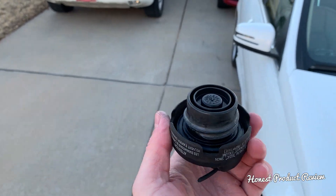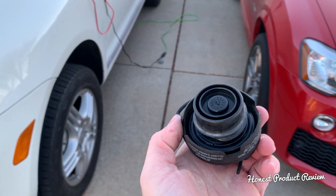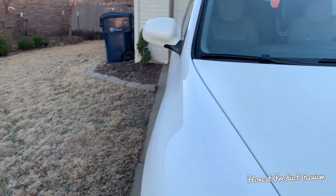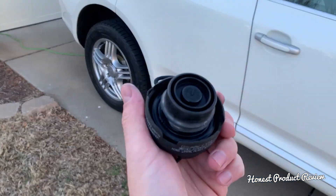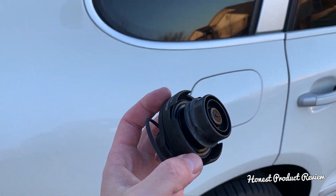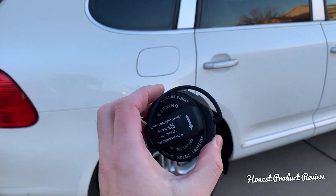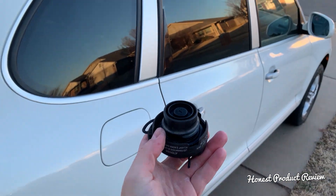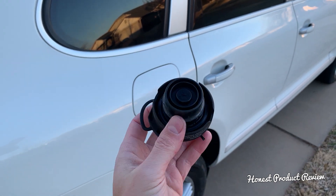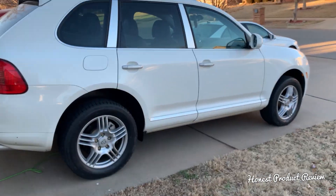We replaced it — you can see the new seal is installed and we'll be getting rid of that EVAP small leak detected on this Porsche vehicle. Even if you have a Volkswagen or Audi, that same seal fits multiple models. It's actually from a Volkswagen since it was cheaper — Porsche charges more just because of the name. This seal fits the Tiguan, Audi A4, A5, A6, A7, Q5, Q7, and multiple others. We'll put the link in the description below. Thank you guys for watching — see you next time.